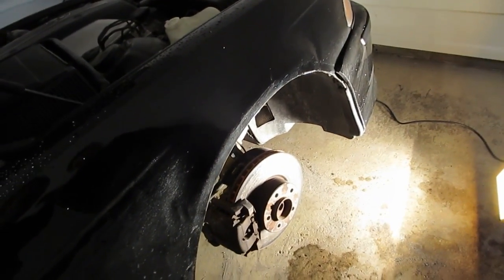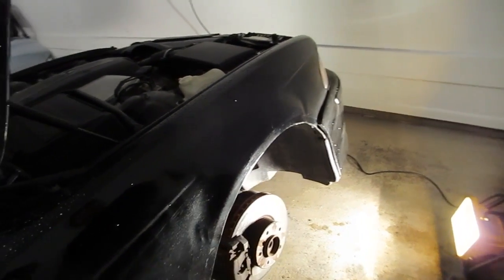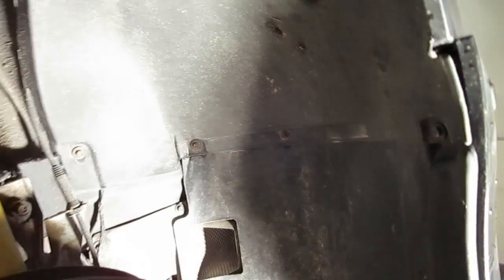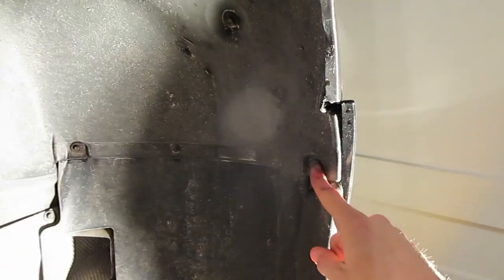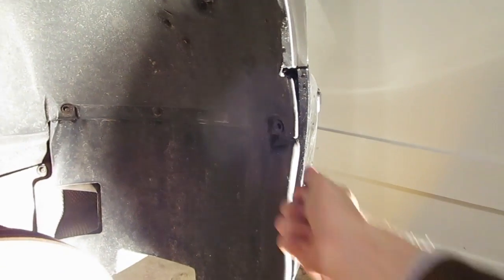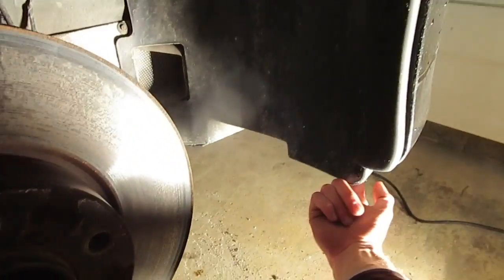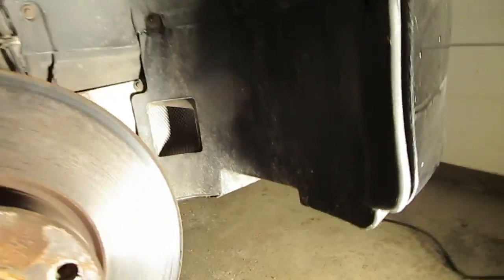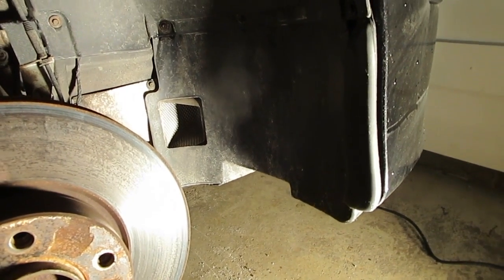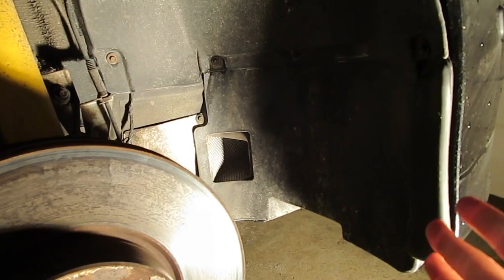Here's what this looks like. Our first step is going to be to remove the fender liners. The front one I've done myself many times — it's pretty simple. We're looking at an 8-millimeter bolt. On the 540 here they use another 8-millimeter, and the M5 just has a pop rivet in there — out with a screwdriver. And then underneath you're going to find, I believe, 10-millimeter bolts — three or four of them down there under the front bumper. There are screws on a 540, maybe, depending on how your car's set up, whatever they felt like using when they put it together.